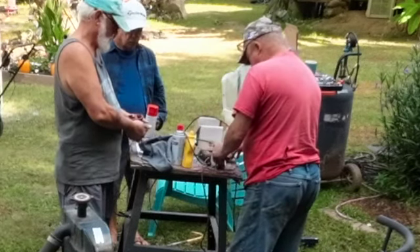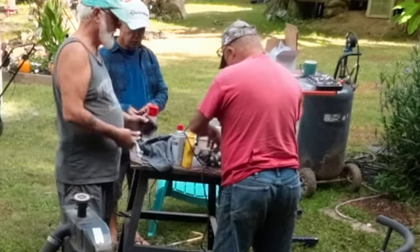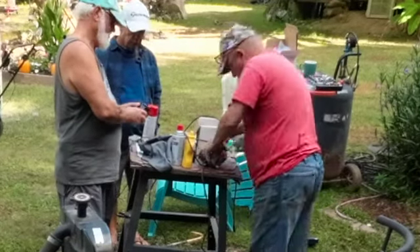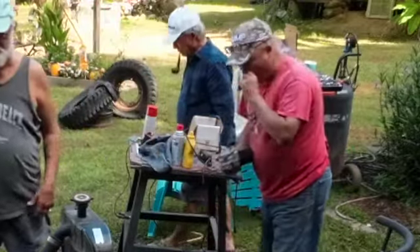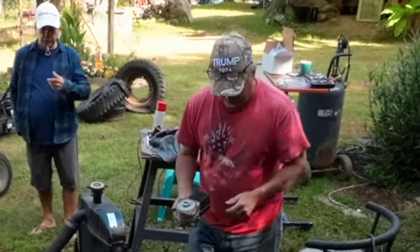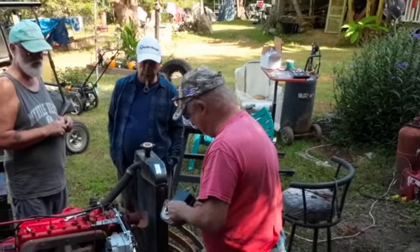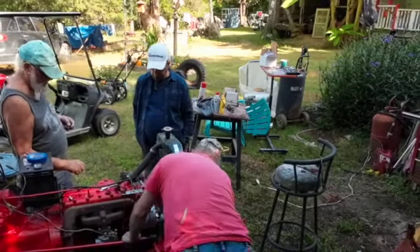Don't talk, just keep doing it. This right here comes off the top of the rotary button — let's take the one you've got and stick it on there. That looks brand new and David said it was brand new. There's no way of getting it really bench tested. If you could spin that little thing you could — you'd have to spin it enough to get it to do something. It doesn't generate — it's either on or off, but you've got to have the power hooked up, and spark plug wire in it. It probably needs to be grounded; it's got a condenser in there.